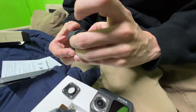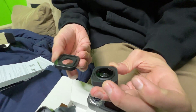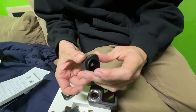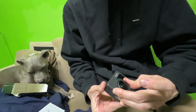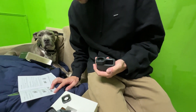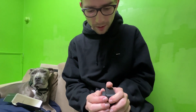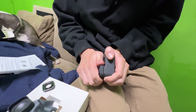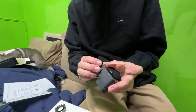Carefully removing the original lens — wow, that's super cool, it's like a whole other lens under there. That reminds me of when you gave me that flip camera in high school and I glued a fisheye lens to the end of it. Alright, you have to start at the 90-degree rotation and line up the notches. Press and rotate one quarter turn clockwise to lock it in. There's no hard click feedback, but you can feel something. Note: your camera must be in max lens mode before recording, otherwise footage will be distorted.